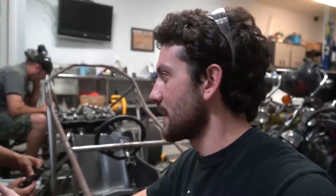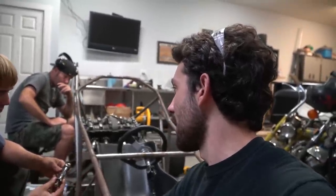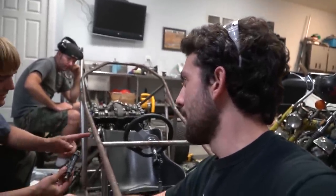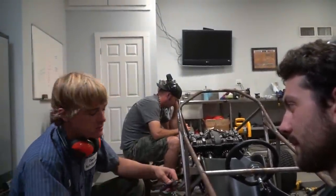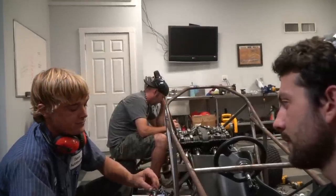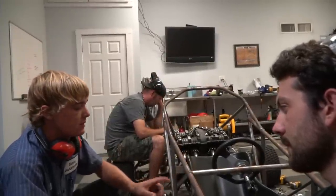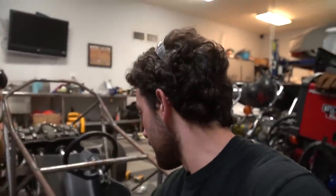Charles just came up with a sweet solution. Robbing parts off of the old 750 frame. So we're just using the factory parts. It led from the reservoir to the two front calipers. This one had dual calipers on the front, which worked out in our favor. So got the single line bolt on both sides. Maybe have to trim this, but it's going to solve our problem. So no more leaks, and we should be able to get brakes working tonight.